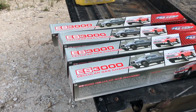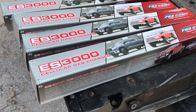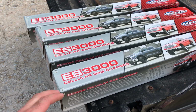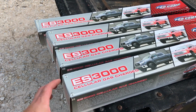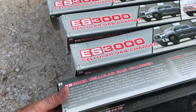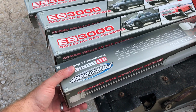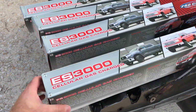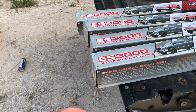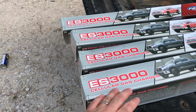Anyway, I wanted to mention, I released a video talking about shocks, the importance of shocks. And so I just wanted to mention that again, why I'm doing the ES3000s. If you look up the ratings for an ES3000 for a shock by itself, it'll say that it is more designed for a light duty, like an SUV or a light duty pickup, and that for a heavy duty truck you should go with an ES9000. But I have dual shocks on the front, so just say you're going to add them up, this is basically ES6000.